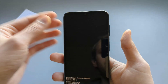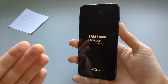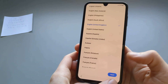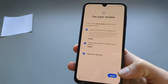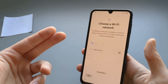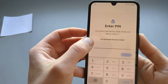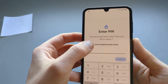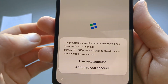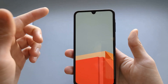We can reboot the system now — press the power button and it will reboot shortly. We will need to do the full setup process since the phone will basically be brand new. Start the setup, choose language, agree to everything it asks, then enter your Wi-Fi details or make sure a SIM card with data access is in, because we will need to connect the Gmail account. When it asks to enter your PIN code and you don't know it, you can use the link 'Use my Google account instead' — make sure to log in with the same account you used on this phone previously, and it will confirm that it has been verified.